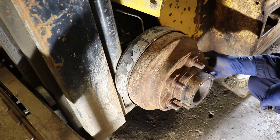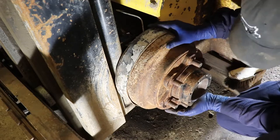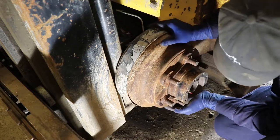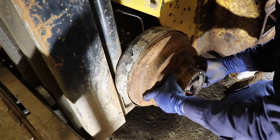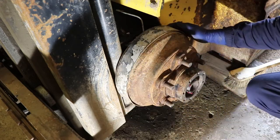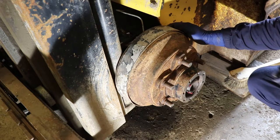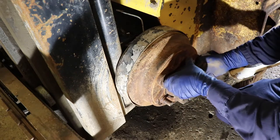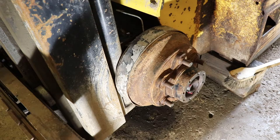So I'm relatively on, not sure if I'm in all the way. It's going to be hard to do the bearing setting - there's too much brake drag. I'm going to pull this off and adjust the star wheel a little bit and slide it back on. Then put the drum back on and start setting the preload on the wheel bearings.